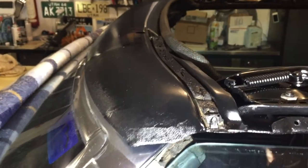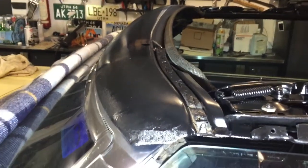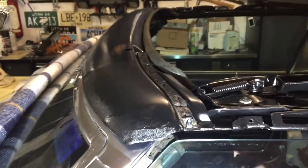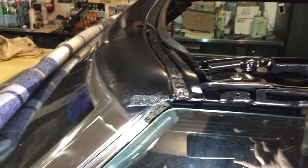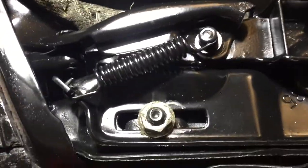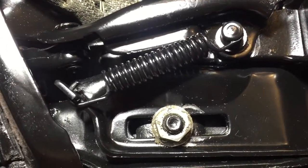Once I have all of those adjustments, then I know I have the frame and this front bow positioned correctly. Then I can start putting on the top pads and the back window, and then we'll move on to the roof itself. Some of those steps you've got to make sure to go through before you get too far ahead of yourself — otherwise you're having to pull a bunch of staples out and reposition the top. So I loosened up this bolt — you can see the markings from when I tightened it down the first time — and I moved it forward about a quarter inch.